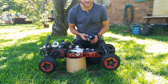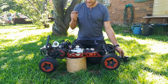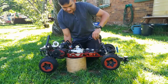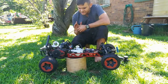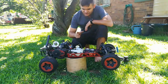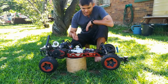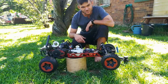Okay let's put it on the track here. It feels like there's a blockage still. We can try and strip that down from the needle and seat. The engine seems fine — the engine is running smoothly, revving through, but the carb is still giving an issue. We'll find out from the customer what he wants to do — whether to still service the carb or just put another one on.